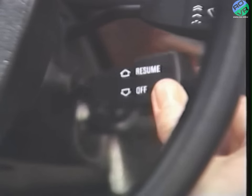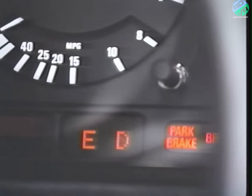If you want to go back to a set speed, just push the lever up. There are also some safety features built into the cruise control system. It will shut off automatically if you move the gear shift from drive to neutral, or if you're slowing down at a fast rate — say, five feet per second. If you had a standard transmission, cruise control would shut off when you stepped on the clutch. And the memory is canceled every time you turn the ignition off.